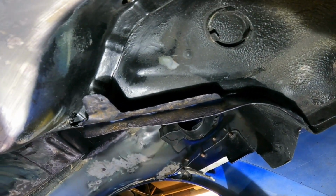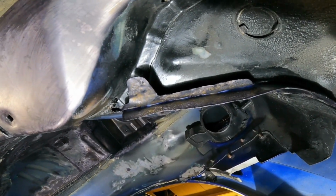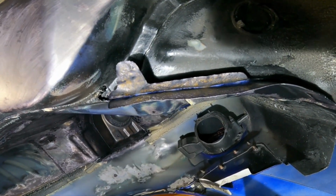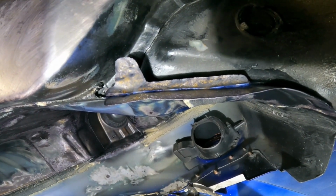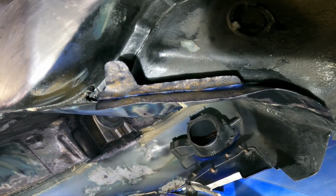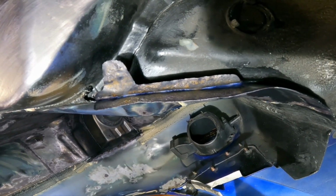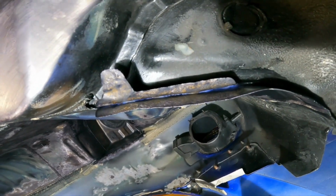This is back of the wheel arch. I've opened that seam out there. It's a little bit of rot up in there. A little bit of pitting going on. I've had some deoxy gel out there. Cleaned it out several times, and now there's some Hydrate 80 just going off.